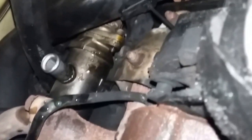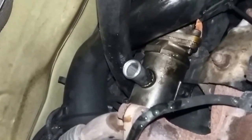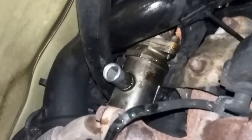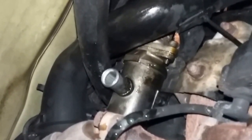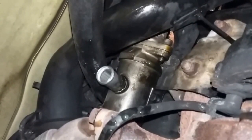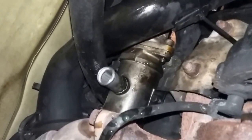Anytime the car had sat for any length of time, you could not see anything coming out. A lot of these things are like that — you just really cannot find them until you get the pressure tester on there and get quite a bit of pressure on it, so you can force a large amount of fluid to come out. Then follow the sound first if it's hidden like this — way underneath stuff — listen for it, then go looking for the drip and follow the upstream fluid.